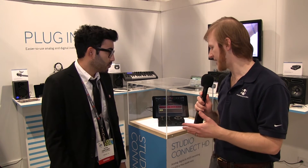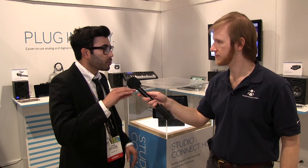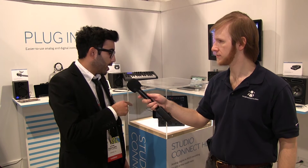You said that this records into four channels. So, since we have just two XLR inputs, how do those four channels work out? Rather than four channels, there are actually two stereo inputs. Each one of those would be a left and right channel — that's where the four come in. So if the app supported it, what you would see would be two tracks, and each track would have a left and right, so that would be stereo. You could select which instruments you are using, two instruments at a time — that's where you get the four channels from, the left and right on two inputs.